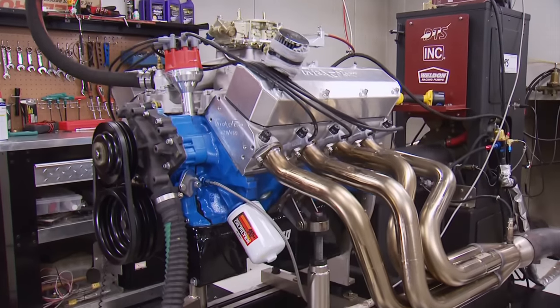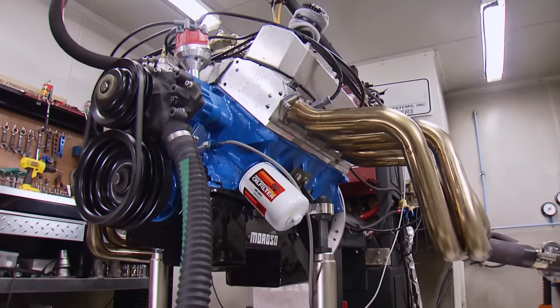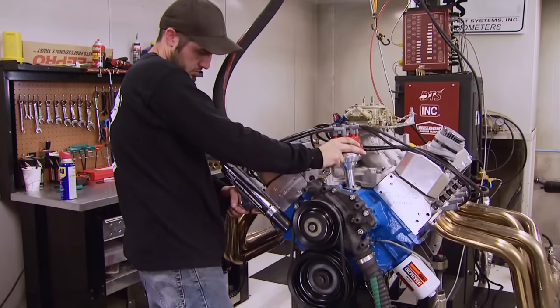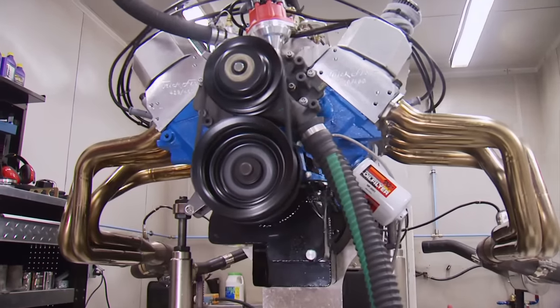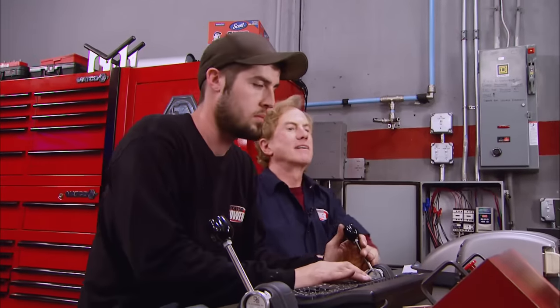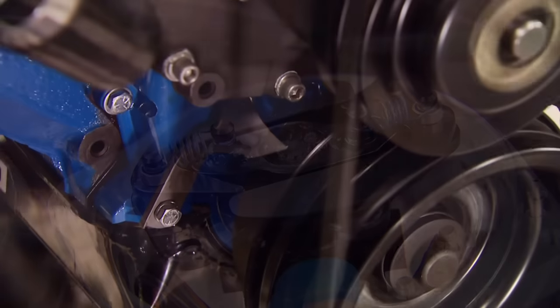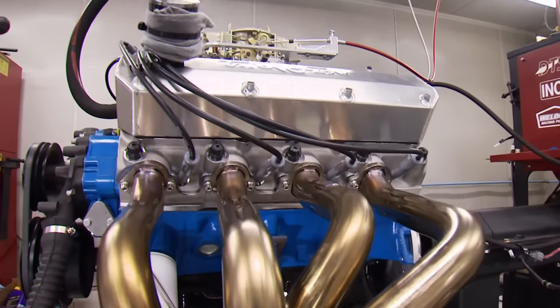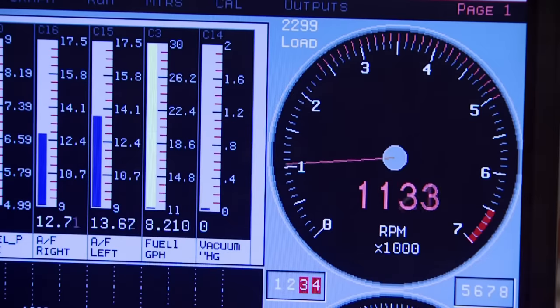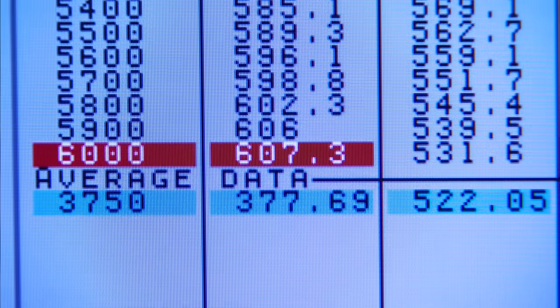The motor's warmed up and we're pumped up, but we're gonna walk before we run too hard. First, a 5,000 RPM pull for 533 horsepower. We're definitely not close to peak, so after a few more runs and some more timing we're ready to see what happens at six grand — 596. Well that's pretty close, but this ain't horseshoes. Surely we can make 600. With lighter springs from our distributor and another degree and a half of timing — not just 600, but 607 horsepower.